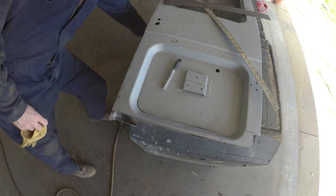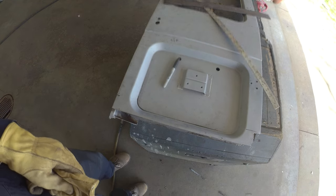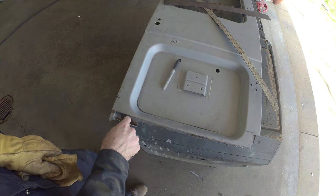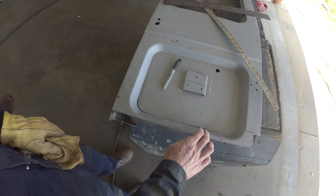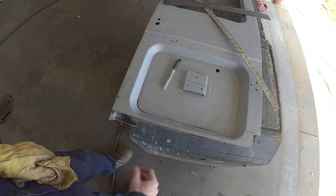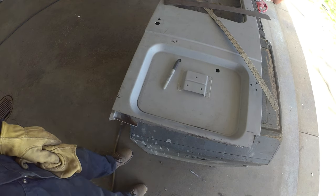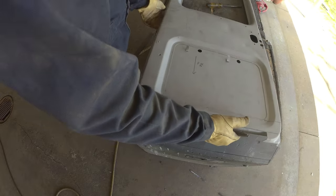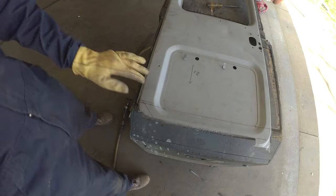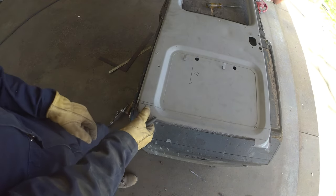Oop, got to sneeze. Achoo! At least we can see better on the backside of this corner flange. That was the main reason for nibbling this off. I did run it through the blaster to get things cleaned up. We're going to have to run it again now that we've got a little more access. But all in all, it cleaned up pretty good inside. Again, kind of the slow and steady wins the race play. If you cut off too much, you're putting metal back, versus if you just keep nibbling away, you'll eventually get where you're going.